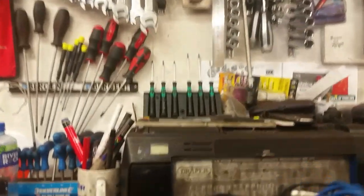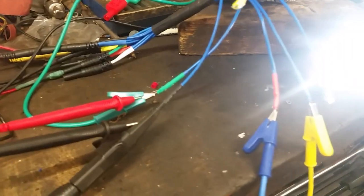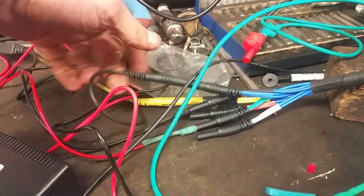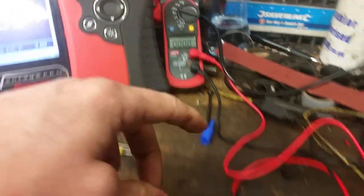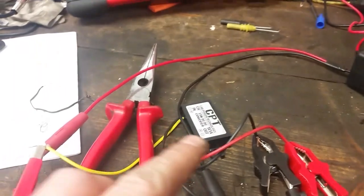You can see our contact breakout leads connected in there. I'm able to measure my signal outputs because they're all doubled up, and the 4mm bananas are outputting to my voltmeter. These are the outputs to the little duty cycle meter - the leads are just sitting in crocodile clips. That's our 5 volts for the position sensor, and this one is the 12 volt supply from the car battery.